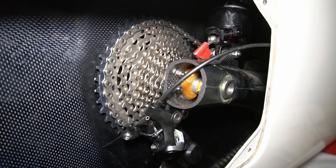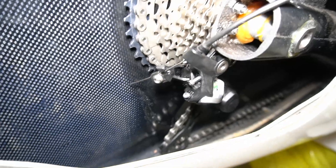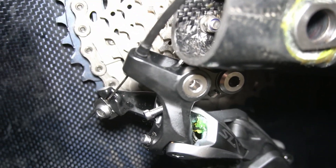The reason I'm looking at this is because, as you can see, I'm on second gear here, and if I point it downward, you can see that the rear derailleur doesn't have enough space to clear. If I try to shift into first gear while I'm in the small gear in the front, it hits the bottom because the pulley for the rear derailleur goes down further.